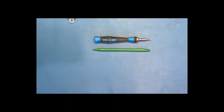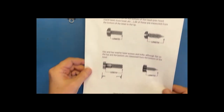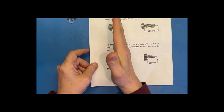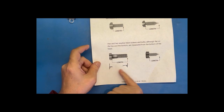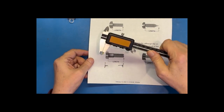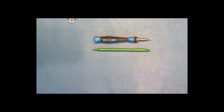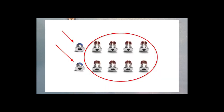One note about the screws: if you look at descriptions on the internet, you'll find that the screw length — which is normally specified as under the head for a screw with a flat bottom — they specify the overall length. You can take calipers and measure it, but it's not the way they're conventionally measured. In any case, keep in mind that eight of the screws are 3 millimeters long and the two over by the Apple MacBook Pro markings are 2.3 millimeters. Make sure you get the same length of screw back in the same hole, as it could cause problems if you put a screw that's too long into a hole designed for a shorter one.